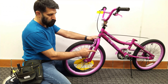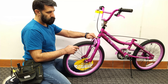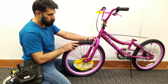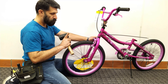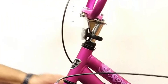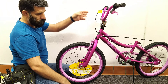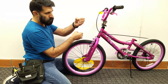If the fork was tilted inward or outward, most of the time it will be bent from the top of the fork, so it's better to change the fork for safety — because if you even try to straighten it, it might break in the bent area. If you want to straighten or replace the fork, there are two nuts and a washer in the upper part of the frame that you have to open. In most models the fork is opened the same way, and in some models it is enough to separate the handlebar and the fork will be released.